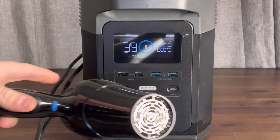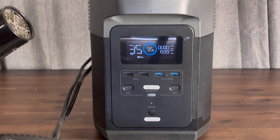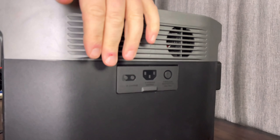Now that it's at full power, we'll go ahead and add that hairdryer as well. This is going to bring us up to about 1800 watts, as you can see on the display panel. Then we'll bring it up a little bit past rated load to see how well it handles a little bit extra past what it's rated for. We're going to bring this up to right about 1950 watts, give or take, and then we'll see how long it lasts. Now you can see on the display we're running about 1940 watts.